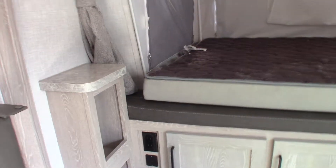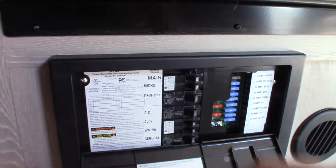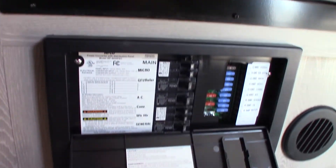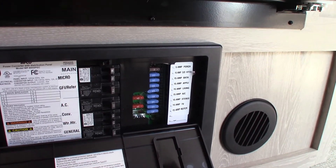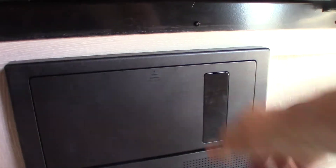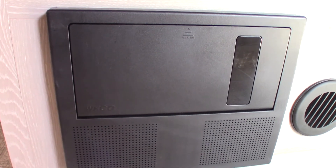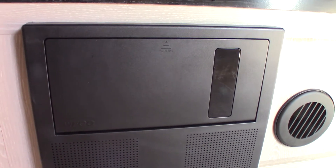The microwave works like any other microwave. This trailer has solar panels on it, two batteries for storage, a power inverter, and a power converter. Converter means you're going from AC to DC power — from 110 AC to 12 volt DC. That's done here at the power converter. You see regular household-type circuit breakers here, all labeled — that's 110 AC. The power is then converted to 12 volt DC; on this side you've got 12 volt fuses, also labeled. This trailer can draw 12 volts from the battery, or if you're plugged in it'll get the 12 volts from this power converter. It's also a battery tender — it'll sense how much energy your battery needs and send the appropriate amps to keep it charged.